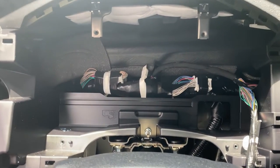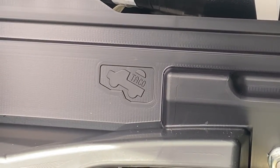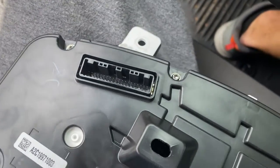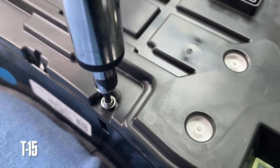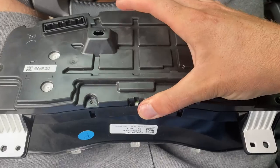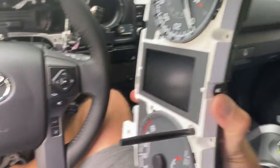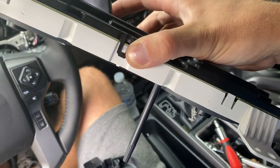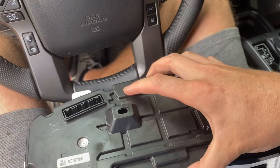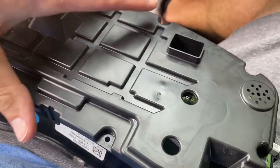Here's the cavity it came from - it's pretty clean. I don't know if that's an Easter egg, but it looks like a taco in the back of that truck. There are a bunch of little screws around here and this was a T15 that I used. Remove each of these little screws all around it, and that's going to let you pull this completely out. You don't have to remove this whole piece like I did, but if you do, be careful not to get any dust in there. These little clips here are what we're going to remove - just slip it up gently and unclip these three clips, and that's going to let the back loose.